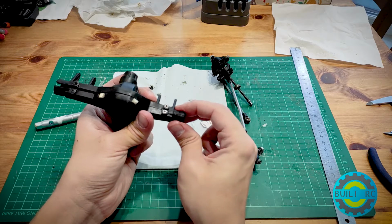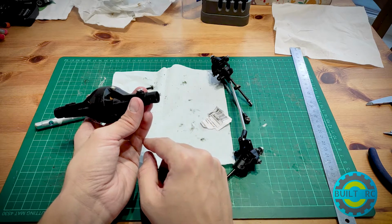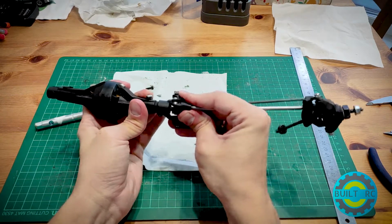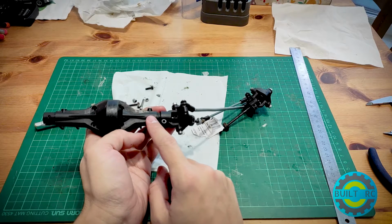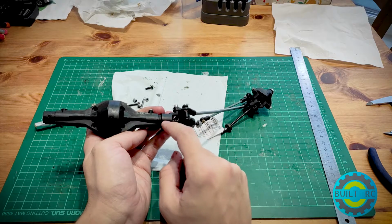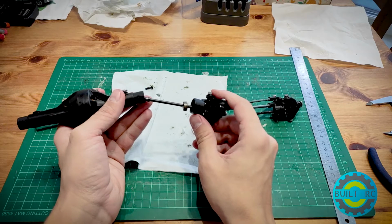So what we need to do is to use some kind of reinforcement tube. We need to place it inside the axle, drill some holes in it and use a common screw to... Just a second. So what we will do is place a C-hub in place, install some reinforcement tube inside the axle, and drill a straight hole, and screw the C-hub, axle, and this reinforcement tube together. So the C-hub will not rotate against the axle. Okay,